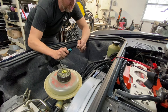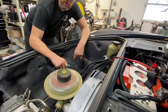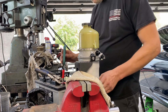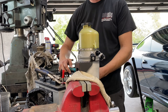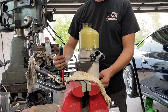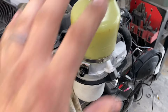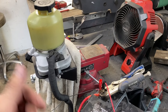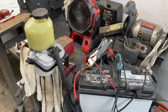Now I'll show you the other way to wire it on the bench, where it will immediately fire off. I'm going to fire this up with the two trigger wires separate — one currently has 12 volts, the other is getting 12 volts right now. You can see it immediately fired off, then slowly spools down. That's just the difference between the two: one takes a little while to spool up, the other fires off immediately. Two different ways of wiring it, but both get up to full speed.